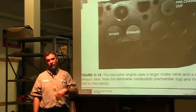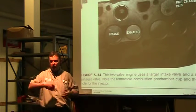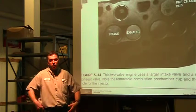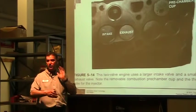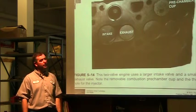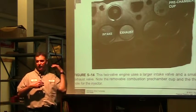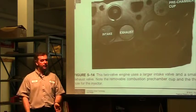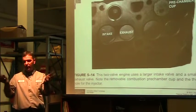If you have leaks in your intake manifold, or your air filter is dirty, then it's going to push dirt in through any crevice and crack that it can. So atmospheric pressure is what's pushing it in there. We speak a lot about it sucking air in, but it helps if you understand it really is being pushed in, not sucked in. If my intake is blocked off or it's really dirty, the piston travels down. If atmospheric pressure can't fill that void, that cylinder will not have any fresh air in it. It's going to come back up. There's not going to be any oxygen. We put fuel in it, we're not going to burn. We're going to see a lot of black smoke.